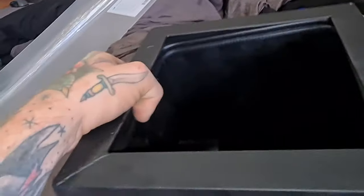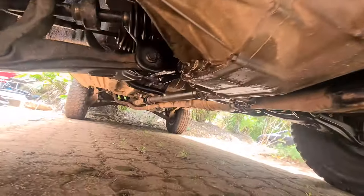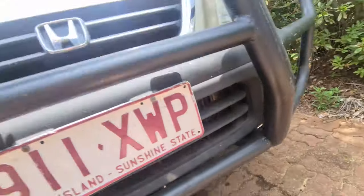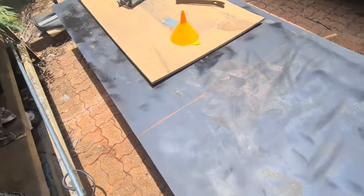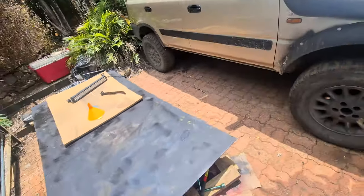This is the bulb-shaped pinch weld I was showing you. I'll end up dropping it to about there, but the lid still easily fits over. I've just basically measured from behind the transfer case to here — it's about here — and giving it an extra 10 centimeters. I'm going to cut off this part which is the excess and then have a bit more room to work.